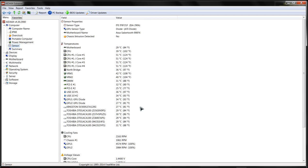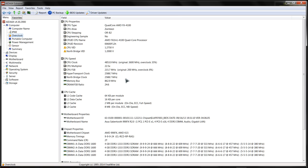You'll notice the first GPU is running a touch warmer than the second one - that's because I plugged the card into the wrong slot. It's supposed to be in slot three, so it's operating at times four. There isn't really much of a performance hit - maybe max one and a half to two percent, almost negligible.